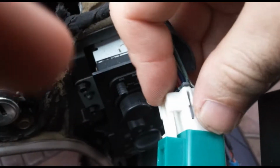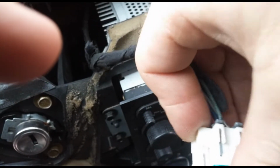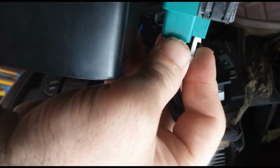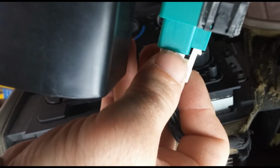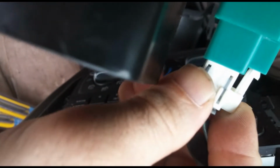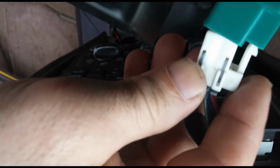and kind of start it at an angle when you put it in, and move it around, play with it until it'll finally pop in there. Otherwise, it's a nightmare, and you'll just keep bending those pins and never get it in. See, I had it in before, and of course, now that I put it back together, to try to do it again, it doesn't want to work. Okay, got it. We're just gonna play with this thing, get it back in again.